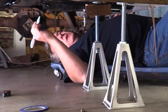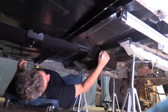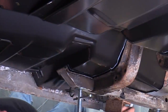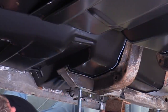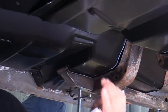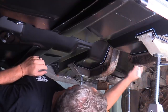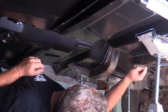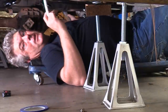We do have a few more miles to go before we can actually weld everything in. Now I'm going to mark up my tunnel for position with exactly what's going on underneath — just going in and marking it up so I'll know where to put my cuts in the actual floor itself and where all my problems are. I'll lay this floor pan out upside down with the tunnel section up so I can know where I'm going to be making my cuts. We're going to go all the way into the back section so we'll know exactly where to make our cuts on that.